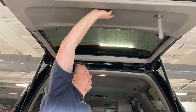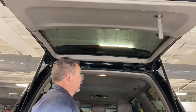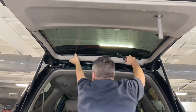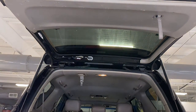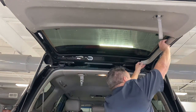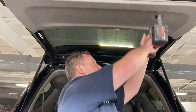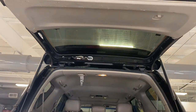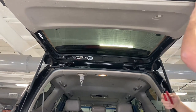I got to take this trim panel off. I only need to get to right here, but the way this thing's put together I got to start taking it apart all the way up here. Got my trusty red handle clip tool. Now there's a bolt under here I'm going to have to take out — there's a 10 millimeter bolt right here. Take that out. Got my red handle clip tool again.